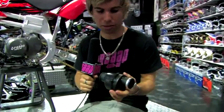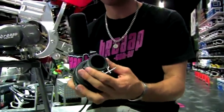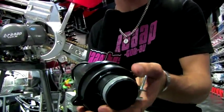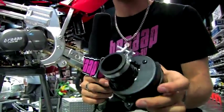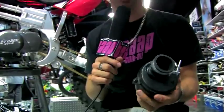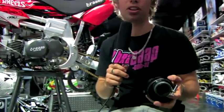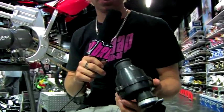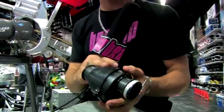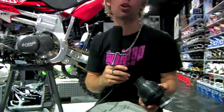This is the new airbox we've designed for the Braapster Maestro. One of the benefits is it works similar to a normal air filter — it bolts onto the end of the carby so you can remove it and work on it at your workbench rather than while it's on the bike like a traditional airbox. It also has a spark arrester, meaning there's no chance on really hot days that the bike could backfire and catch alight. And it has less surface area for water ingress, so on wet days it's going to be awesome.